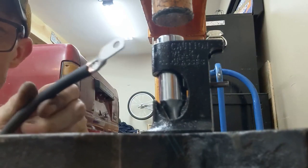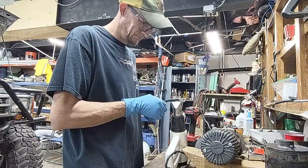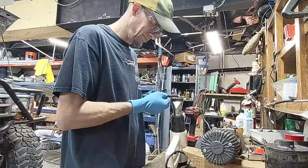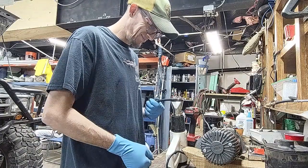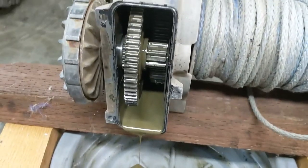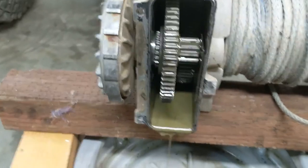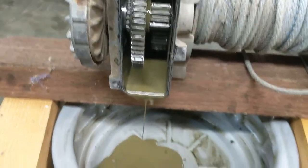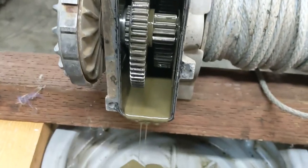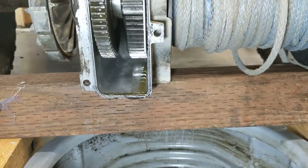There's what our crimp looks like. We'll put some heat shrink on these and get them all finished up. The mock-up is done with the upper case — the heat shrink is all done and everything is ready to fit. I'm going to go ahead and transition to cleaning up the lower case and changing the fluid. I had a little bit of water intrusion, but that's what happens when you live outside for 13 years. Gears and everything else looks right. I was using the synthetic oil in there, so I ran a couple cans of brake cleaner through there — now she's all nice and shiny again.